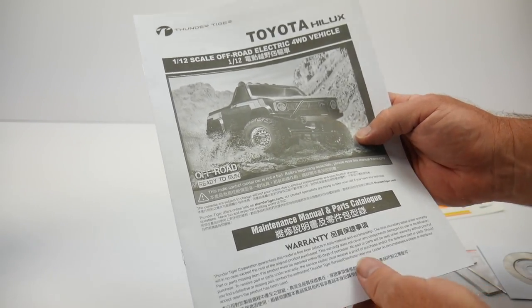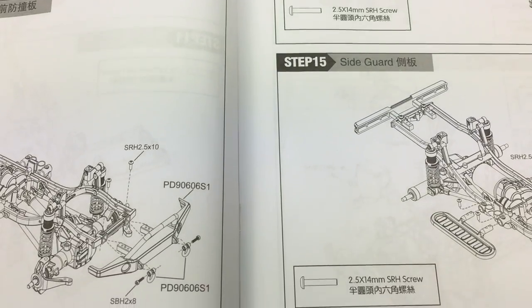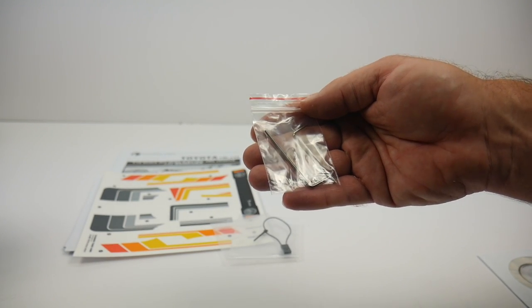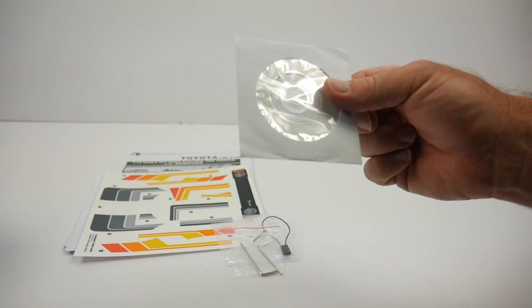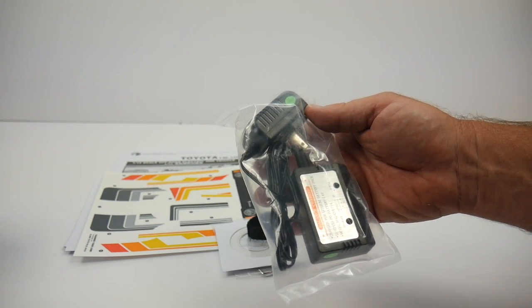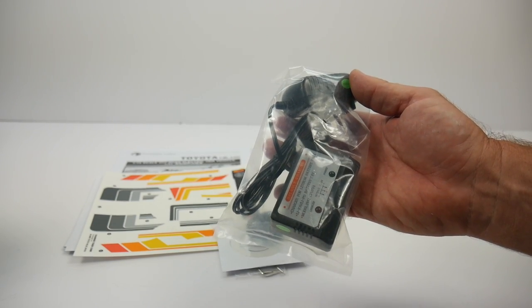The literature provided includes a decent owner's manual with model numbers and part numbers. This is a hobby grade RC so you are able to replace or upgrade parts down the line. You get a user's manual for all electronics, a full sticker sheet that gives you the option of a vintage look on your Toyota Hilux, a bind plug, two allen keys (1.5 and 2.0), all metric hardware. There's also a tiny CD-ROM — not sure what to do with that in 2017. You get an extra battery strap, more on that later, and finally a lithium wall charger that charges off the balance plug of the included 7.4 volt 2S LiPo. Expect long charge times with the typical wall charger.